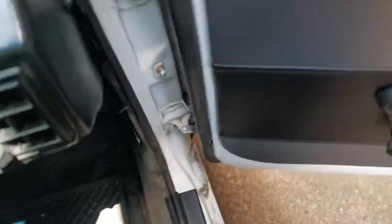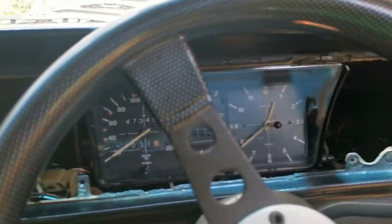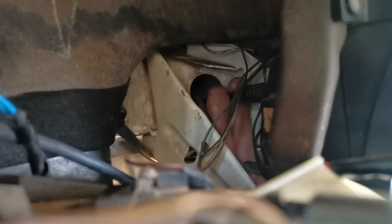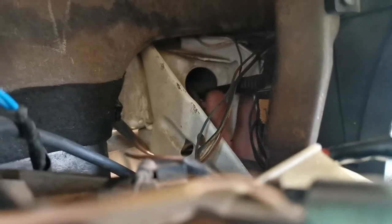I'm gonna come in front here and show you guys. You're gonna strip it down like this — I've stripped it down already. I'm gonna put my hands in here at the back. You see my fingers there? Because I've got one hand I can't use both, and obviously you're not gonna be using a phone or camera. So you're gonna put your fingers in here, unclip it and pull it to the back, pull it out — and that's your speedo cable. It's gonna pull out completely.